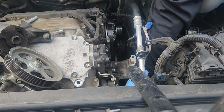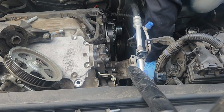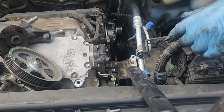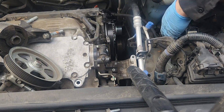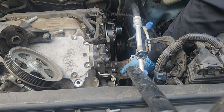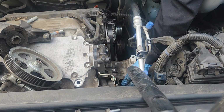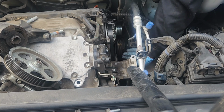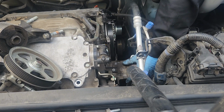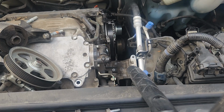Okay, pull the harness off the back cover. Pop that one out. From here, I'm going to go ahead and unbolt the inner part of the motor mount. 14 mils, 2 up top, 1 down in the middle. It is captured by the lower portion of the timing cover, so after we pull the balancer and the lower timing cover, the whole thing will come off. The water pump's behind this, so this does have to come off. So we'll go ahead and pop that now.